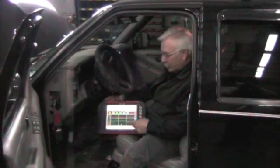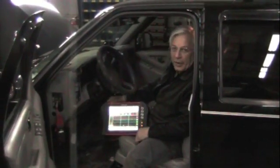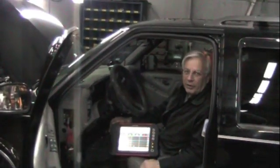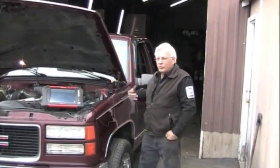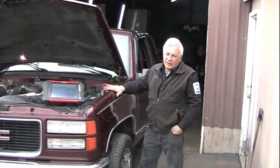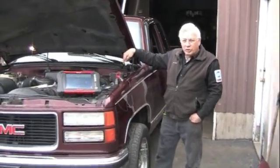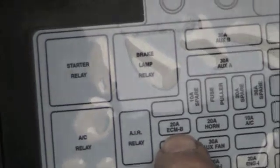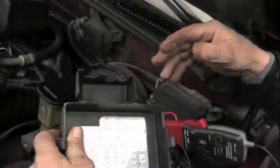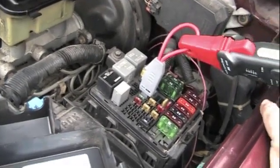After changing the fuel pump, you can see the new pattern — a nice electrical pattern. You've got fuel pressure back, and the engine accelerates well. Learn to use your equipment. It will help you not guess, but find evidence so that you can be sure of your repair. That's how to hook it up on a Chevy Blazer or Chevy S10 — anything where the fuse panel is inside the door, you can do the same thing. This is a 97 half-ton 350, probably 96 through 2000. The fuses are right down here underneath the hood on the under-hood fuse box. When you take the fuse cover off, you see the 20 amp ECMB. Don't take my word for it — use your electrical diagram to make sure you're on the right fuse. You pull the fuse out, hook up your fuse bypasser, hook up your amp clamp, and you're ready to look at your pattern.